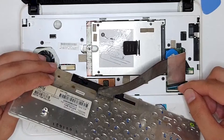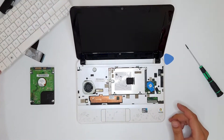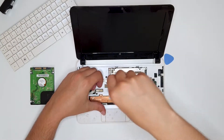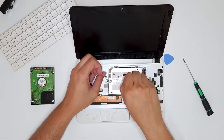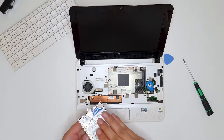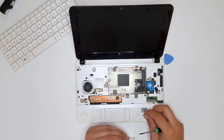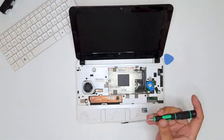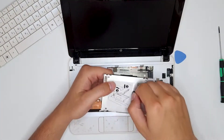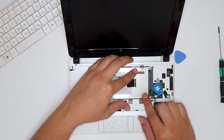Back it a little bit, turn it around, and pull up the thing that holds the flat cable — and the keyboard is out. Now unscrew the HDD holder, pull it back and plug it out. Put the hard drive inside — we need four screws.